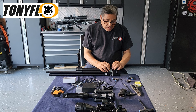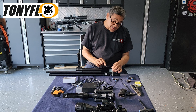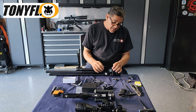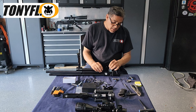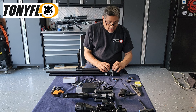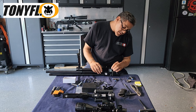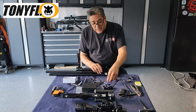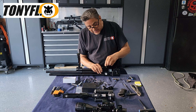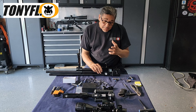Find your right size Allen key and pull that grub screw back so you don't ruin the threads on the cap or the bleed valve. Once that's clear, you can use two Allen keys put through the little holes that the cap has. If you have snap ring pliers it'll be easier to break the cap loose — I don't have any here.